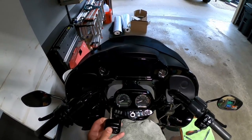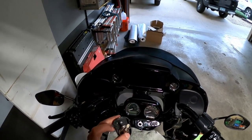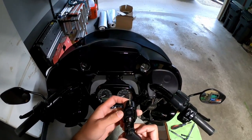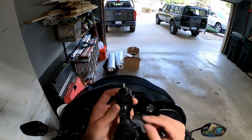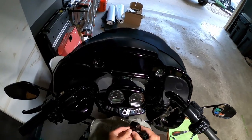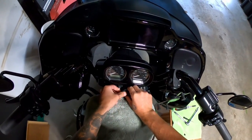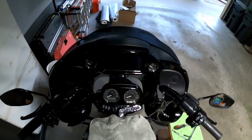Remember — if you try to put this ignition piece in right now as it sits you're going to have a hell of a time because it's not going to work. What you want to do is push in this little knob, this little tab right here, then stick your key in and turn it to the left. Your key is essentially going to sit perpendicular to your ignition switch, past the unlock portion — that's how you know you did it right. That's going to allow you to push it in all the way. Get it lined up, make sure you keep your spring in there, you can see in the hole how the key needs to go. Push it all the way down and it pops out — you're good to go.